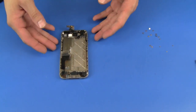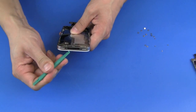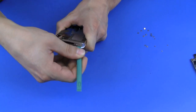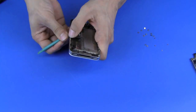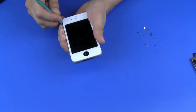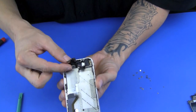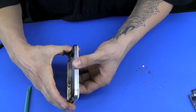After removing the screws, we're going to remove the display portion from the frame assembly. It is double-sided taped down, so we're going to get in with the corner of our plastic tool and follow all the way around the edges. The cables are located right here — when taking the display out, be very careful because these cables are going to come out with the display itself.